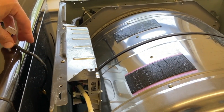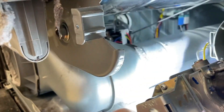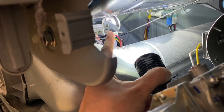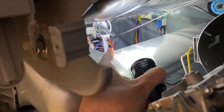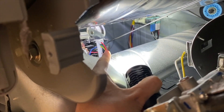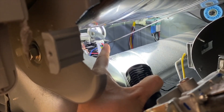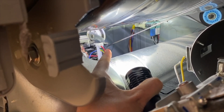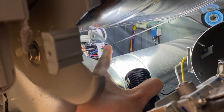Coming down below, this is probably the most tricky step. You have your idler pulley way back there — that white roller — and your belt. Reach in and you'll notice a spring. Push that pulley away from you to put more tension on the spring and carefully remove the belt from the idler pulley. Take plenty of photos first so you know exactly how the belt goes back on. It loops around a motor down below as well as the upper idler pulley.